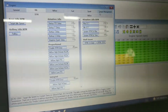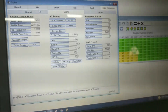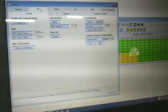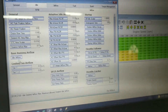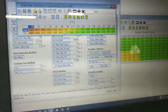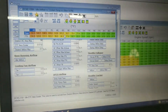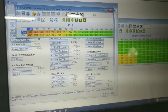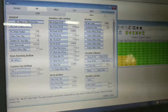Also under idle airflow, you'll need to change your base idle airflow value depending on how far off your STIT and LTIT — short and long-term idle trims — are. You need to get that value close to zero before the AC will even turn on.